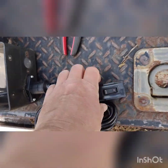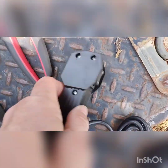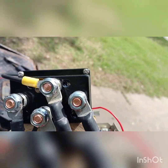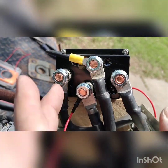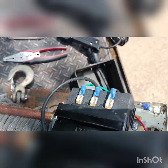Got my cover off, bulkhead connector, switch works great. If you're concerned with the in and out not doing what you expect, just switch these two outer wires around - that'll reverse directions. If for some reason it doesn't work, you could always switch your motor wires. Here's the connectors - they're marked plus and minus, so negative to the battery, positive to the battery, your winch motor. You can switch them if you need to switch direction.